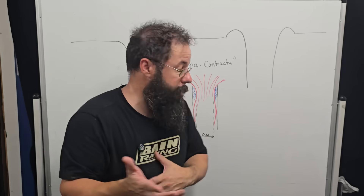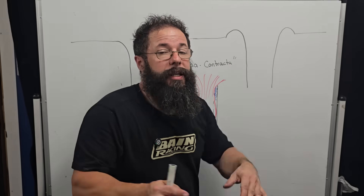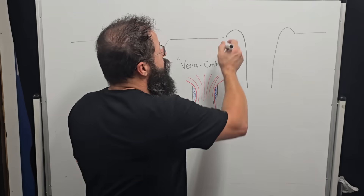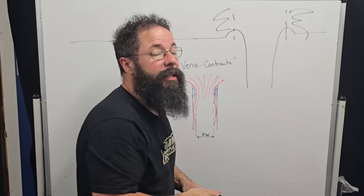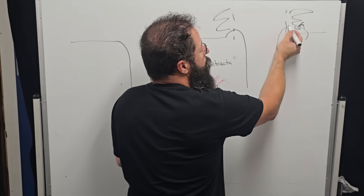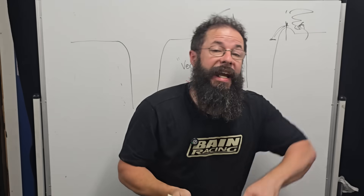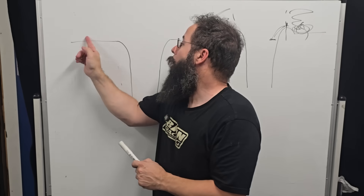Naturally, if we look at any radius in a manifold, it's controlling airspeed. So straight away we can say: anything out beyond the turn is meaningless — because what is that controlling? It's not controlling anything. The radius or the turn starts here from this point to this point. So anything beyond that is useless — that makes it dead space. And this is why we delete it.